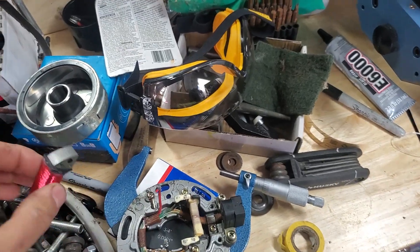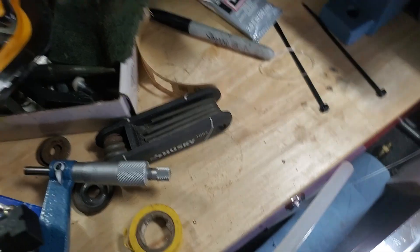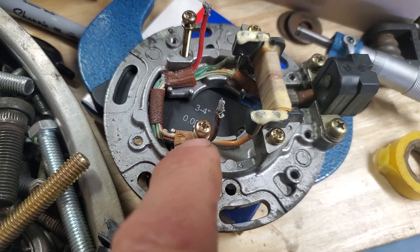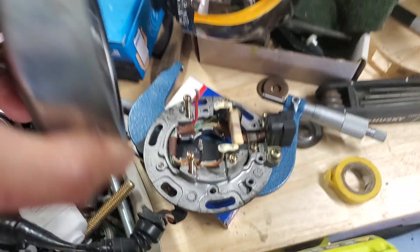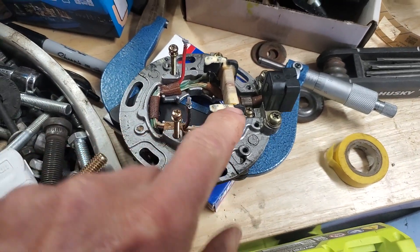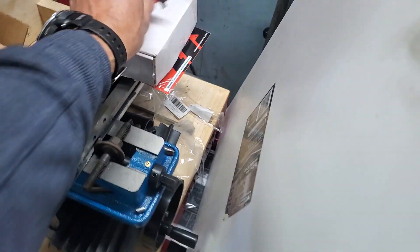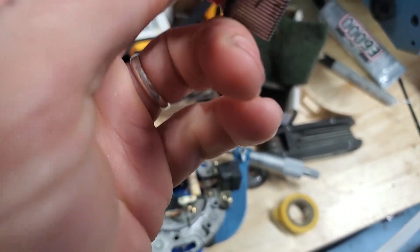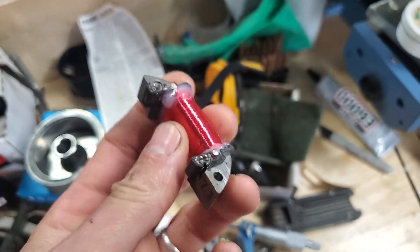What I could possibly do is put some clay on top of that, then lightly tighten it down, pull it off, and just see that I have at least three quarters of a millimeter clearance between the tops of these solder joints and the flywheel studs. Because it really sucks having them kiss and short out after going through all of this.